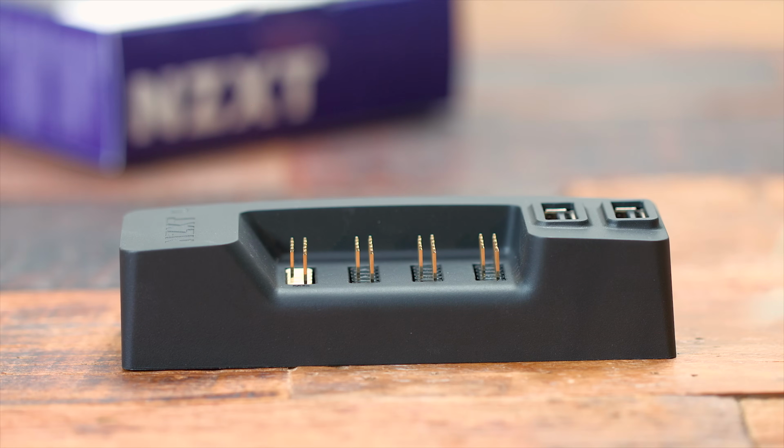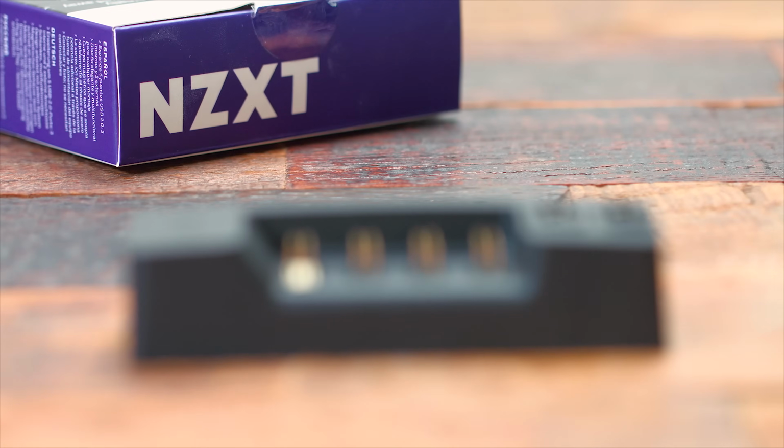This would have made it that much easier because you just plug one of these into your available motherboard slots, and then from there, you use the Molex connector to power it up. You then have 3 extra internal USB ports here, plus 2 external USB ports.